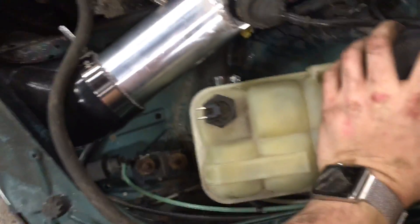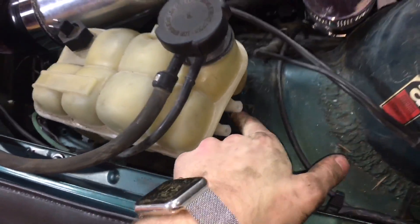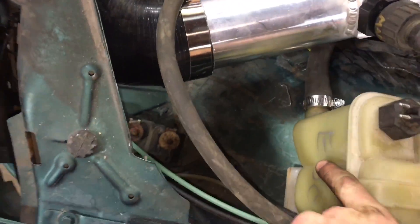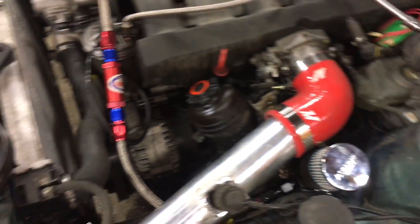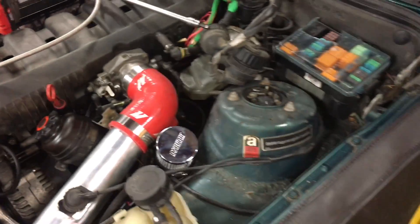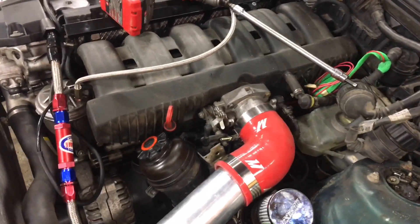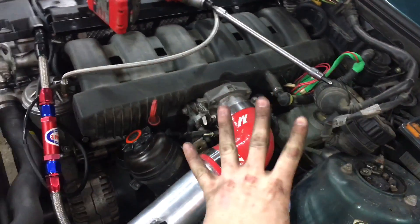It has coolant in it. I got an expansion tank from an 89 325i, but unfortunately the chassis is not really set up for it - normally there's a little stud here and a bracket down there, so we'll have to do something about that. Still need to mount the catch can and the power steering reservoir - lots of tidying up in that sense still to take care of. I found out the throttle body was held in with two finger-loose 10 mils, so that's sorted - now it has four fairly snug ones. Huge upgrade.